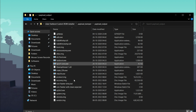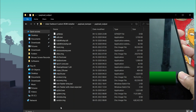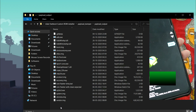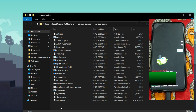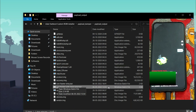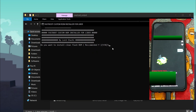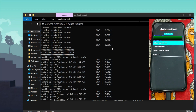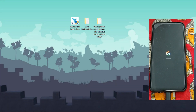Once extraction is complete, go to the payload output folder where you will find the extracted files. Since we are doing a clean flash, there will be two options: clean flash and dirty flash. In the meantime, power on your device into bootloader mode by holding Volume Down and Power for five seconds, then connect your mobile to the PC. Click on Clean Flash, type Y when prompted and press Enter. It will start flashing the custom ROM on the Moto One Vision Plus — I am speeding up this part as it takes some time.